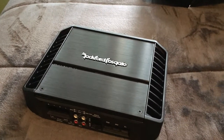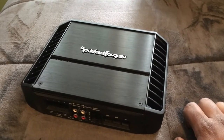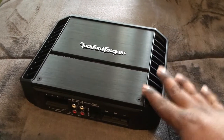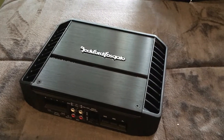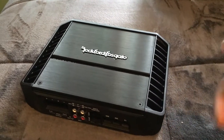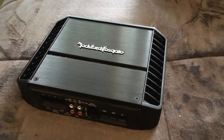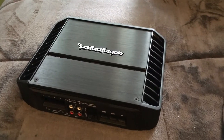Even though this is like 100 to 150 watts less than a Prime, at $120 I'm not losing anything by getting it. So we'll base the whole system around this, but I will run oversized wires and really set it up so that if we do need to upgrade in the future with a different amp, it's already ready to go. So stay tuned.